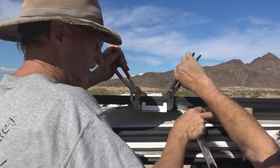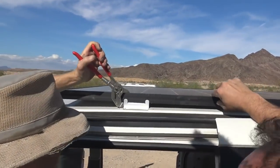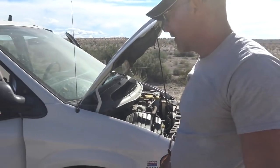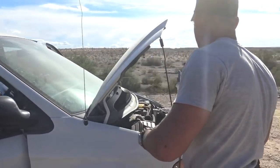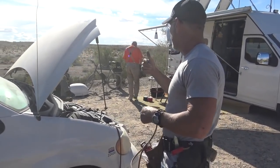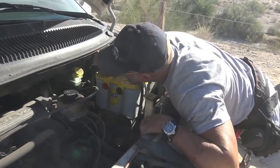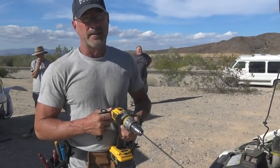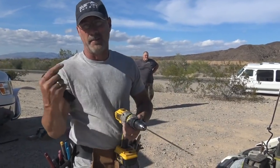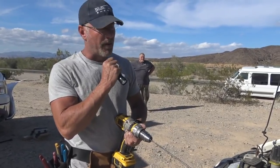At this point, I need to get through the firewall. I've determined I'm going to go through on the driver's side and then pass over to the passenger's side when I get to the end. I'm looking for places on the firewall to go through with my wire. When I do something like that, it's good to have a pilot bit. I look for things in the firewall to identify where I am on both sides — in this case, I'm using the throttle cable. So I'm going to come out right beside the throttle cable and run my wire.